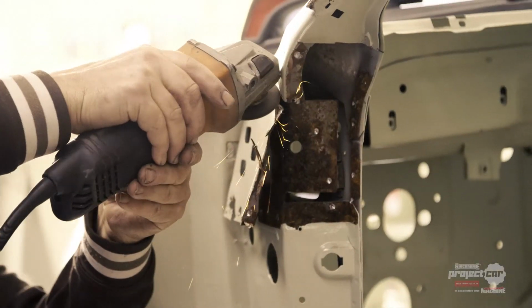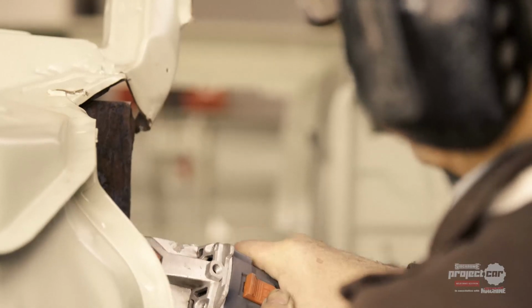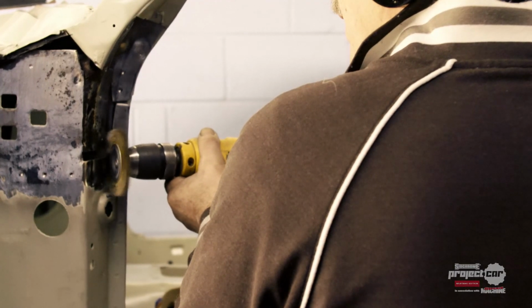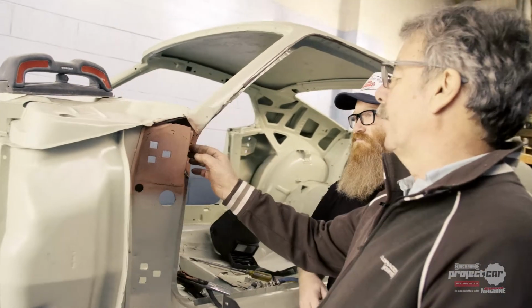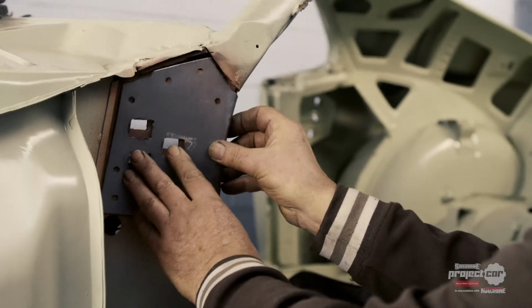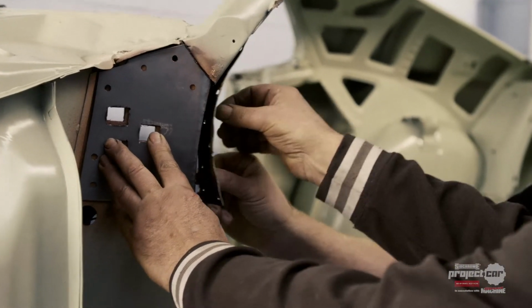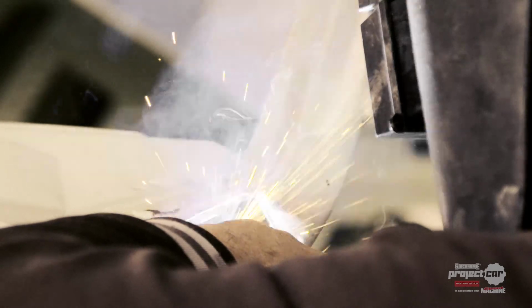A lot of people buy a cheaper car and they buy a lot of problems. Yep. This car has got a little bit of work to do, but basically it's a very good car and it'll make a very good product when it's finished. And what have you got stuck into first? Doing the hinge pillars first, they were both a bit rusty at the top, so underneath here there was a main brace which we've put one end in, put a new section over there. This section will fit in here, and then this section will go back under here, so they'll all be welded in back to original strength because they need to be strong to support the doors.